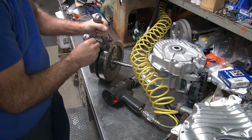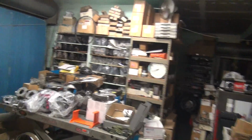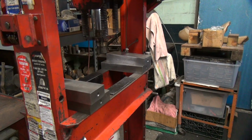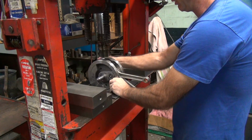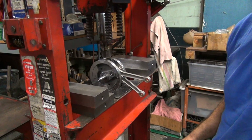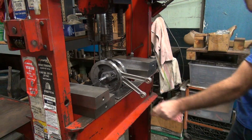Okay, so now we go back over the press. Scooby's giving me a dirty look over there. Let me go over here and torque it. Look, it's almost 8. So, same deal, turn it 90 degrees almost. You let the press do the alignment and holding for you. I'm keeping the fat part of the rod on the table there.